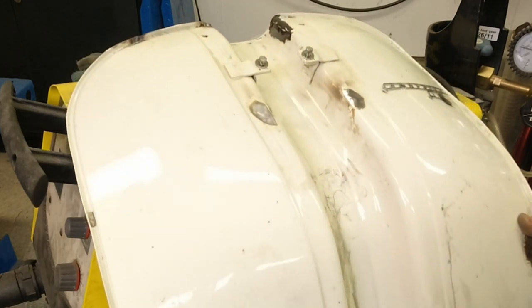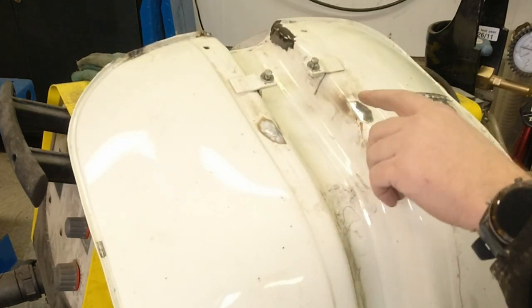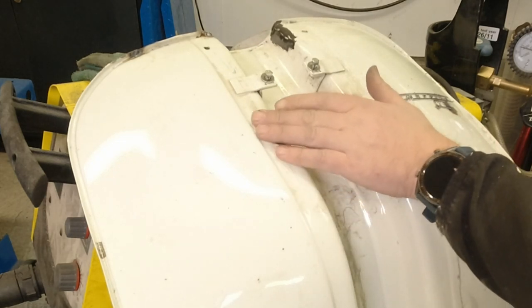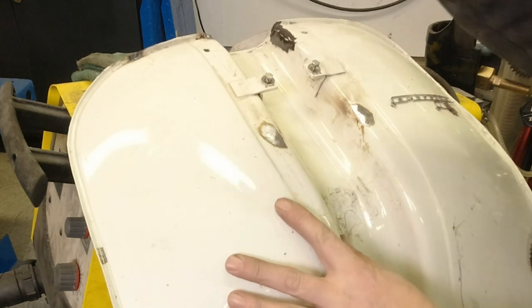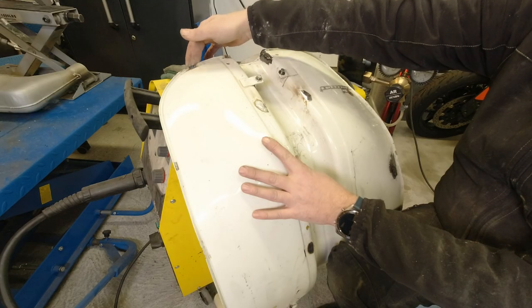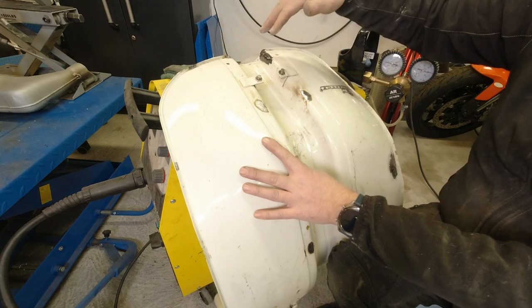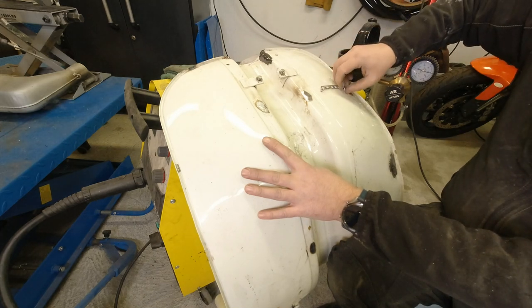As you can see, I've got the holes welded up here and here. What I did was I welded them up on the other side — the opposite side — because if you're getting a blowout or anything like that, it ends up on this side. Now obviously this bit here is not going to be seen, so he doesn't have to mess around with that too much. I had a split on the top here — I did the same there, I welded it on the underside so that you can't see it on the outside. And I had a corner split here — unfortunately it blew out a little bit of metal, but that's sort of hidden by the chrome ring, so that's not too bad.